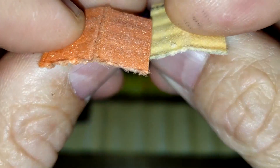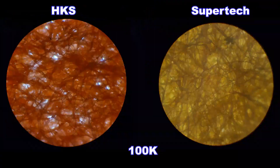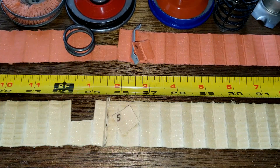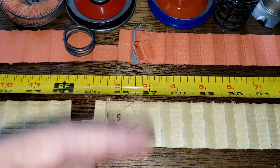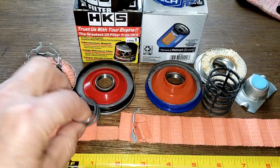Under a microscope the Supertech looks like it does a better job of filtering — the HKS oil filter has a lot of light spots where you can see light coming through the filter media. However, you have about 20 more square inches of filter media with the HKS. If you need more capacity, you could actually use a bigger Supertech — the 7317 — which would give you more filter media. These two were compared because they're relatively the same size on the outside. Also worth noting: the HKS has a coil spring.